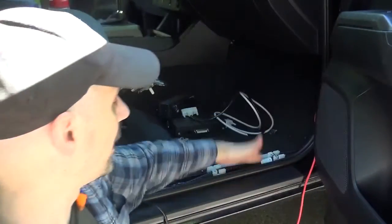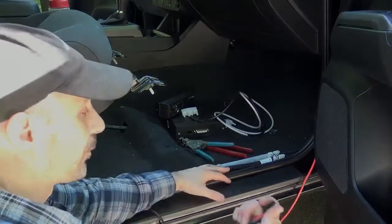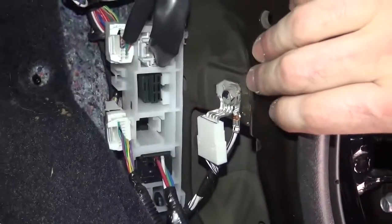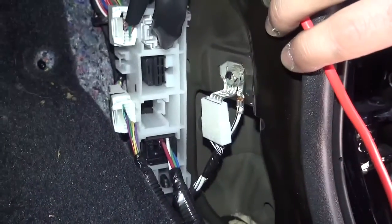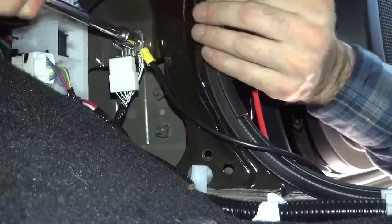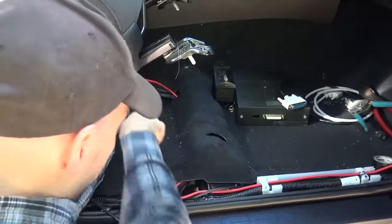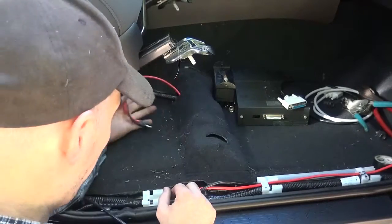Since this particular installation is a remote head kit mount, we're going to be mounting the radio underneath the passenger seat. The grounding lug common to almost every vehicle — you're going to find something in this kick panel on the right side. This is a 10-millimeter master grounding bus. These bolts are everywhere in most vehicles nowadays, so you'll find an easy place to ground it inside. We're just going to run the wiring through the existing chase and then right underneath the passenger seat. Just ran the power cables down. Underneath the carpet, there's an existing wiring harness — very simple. Now we have power from the battery in a well-grounded source right underneath the seat.